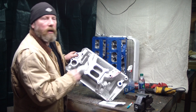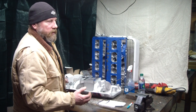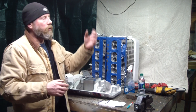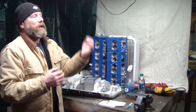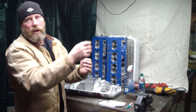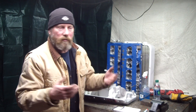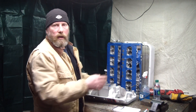You're looking at this column of air rushing into one side, and they're all pulling in the same direction. With an open plenum you're going to have pulsations going in there, especially at low RPM, because there's more time. If you were a piston going down — especially near cylinders 5 and 7 because they're right next to each other — would you rather pull air through a whole carburetor and down an intake manifold column? Or would you rather just take a shortcut and suck from the other intake valve that's open during overlap of a racing cam? If you can get those cylinders apart from each other, they can't take that shortcut.